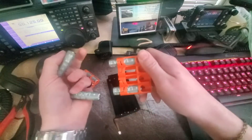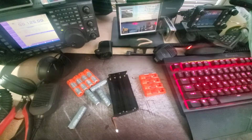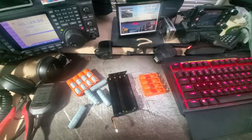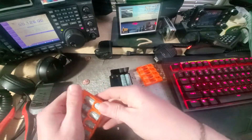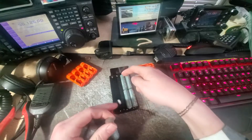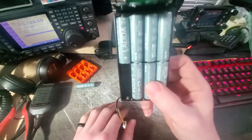I think I need more light, I'm gonna turn on my studio lights. Okay, hey look at that, a little bit easier to see I think. So when we put these in here, they get a little bit too compressed — they're too tight. There's not enough wiggle-waggle room within the battery tray, and that prevents the batteries from sliding along the spring tension and making good contact. So we're gonna modify the battery tray to fix that. First, we're gonna understand what the problem is.